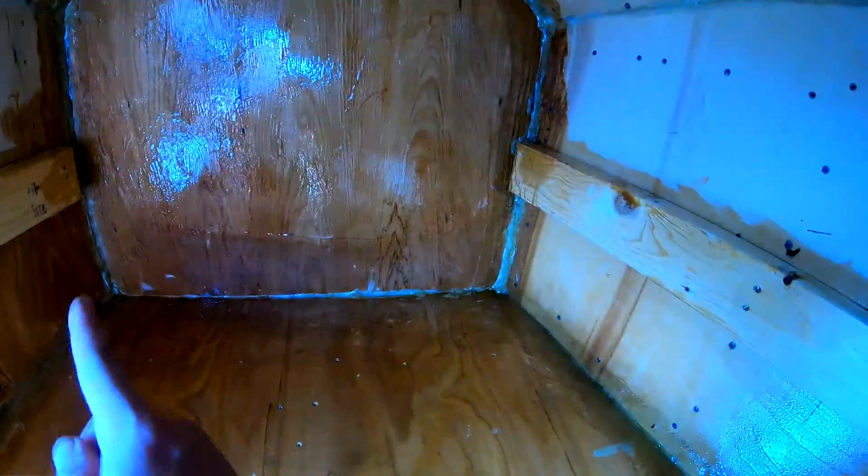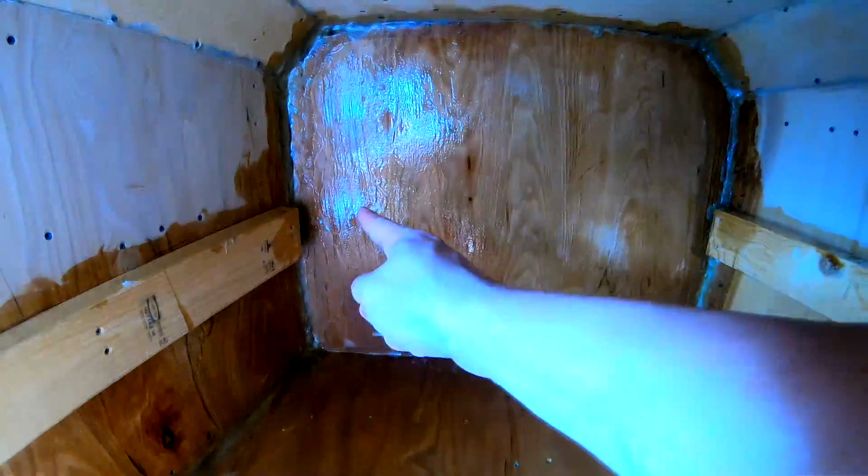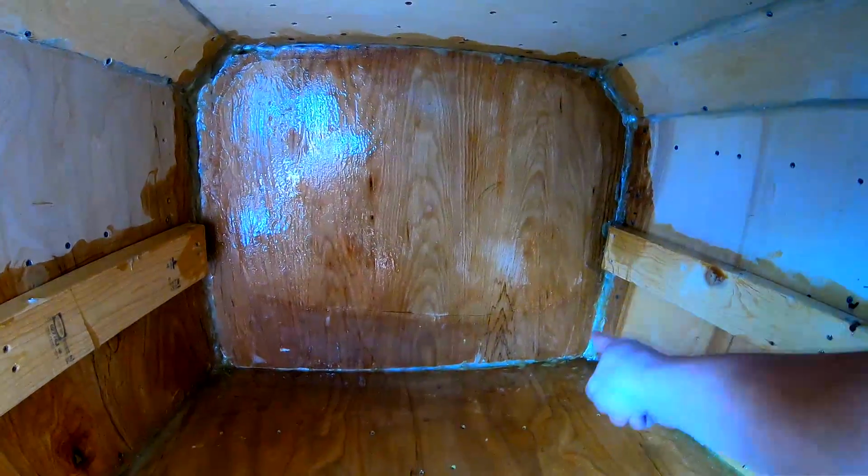You can see there's pieces of fiberglass still in there. It's wet, so you kind of can't see it well on camera, but it's there. So we're fiberglassing, put fiberglass on all the corners just in case. It's glued, it's strong, it's perfect, but a little reinforcement never hurts, especially when dealing with this much power and SPL. So that's what we got. We got fiberglass right there on this corner, all the way up in the back corner as well, all around. So we got that part done.